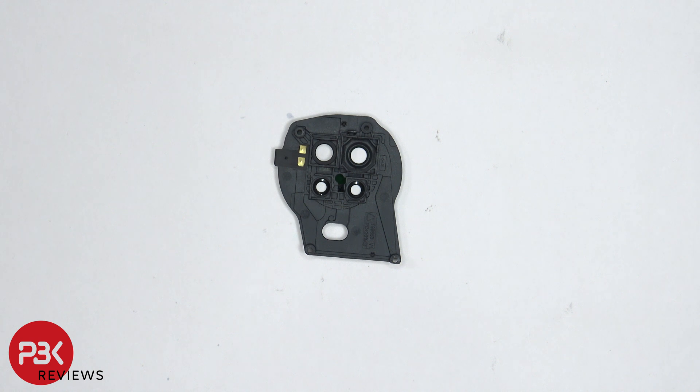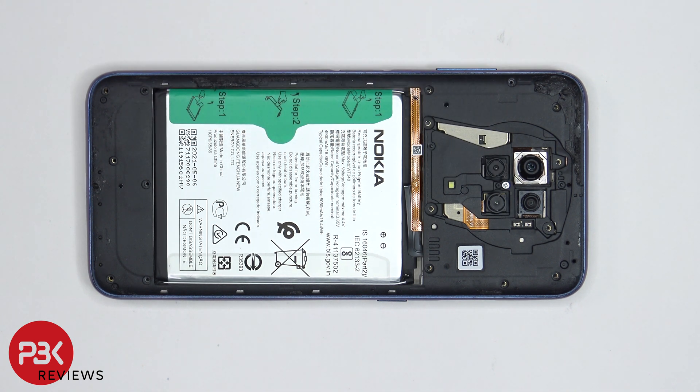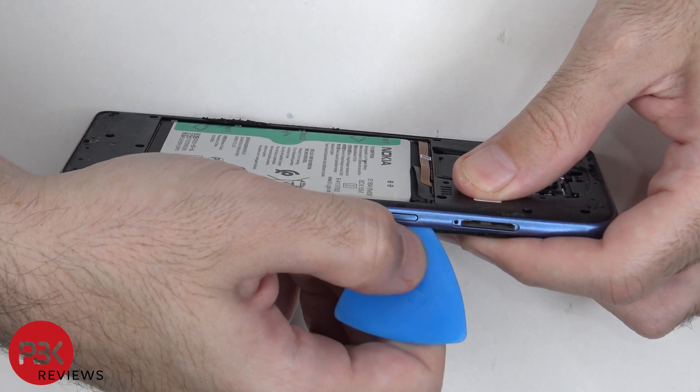Here's a look at the other side. These are the two contact points on the flex cable for the NFC antenna. Now once that cover is removed, we can see another Phillips screw in the center of the cameras which needs to be removed. Now we need to place a plastic pry tool in between the back housing and the frame of the screen and run it along the edges and pop off the catches.